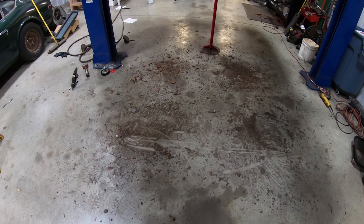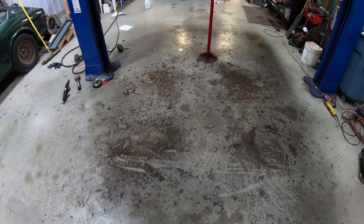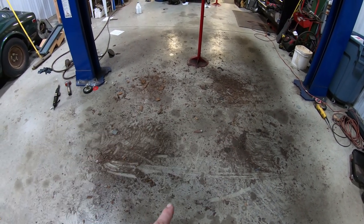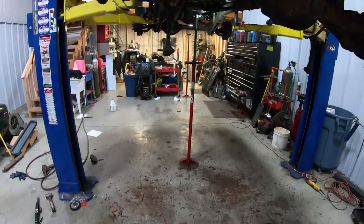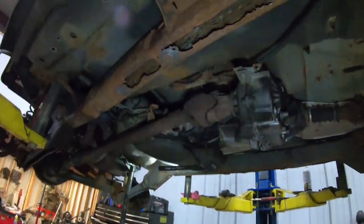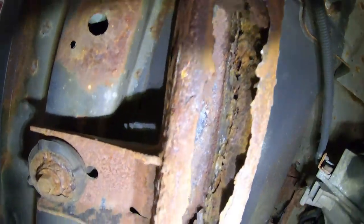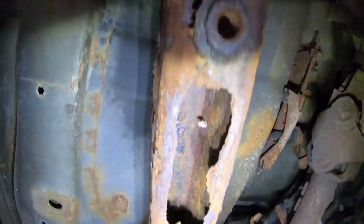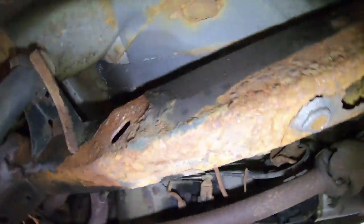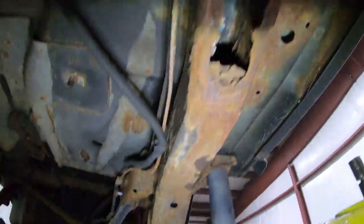You see all that stuff on the floor? We haven't even cut anything yet, we haven't started cutting the frame - this is all just stuff that fell out from taking bolts out of the thing. Luckily we got the skid plate down and only had two bolts that spun in the frame. But take a look at this - that's definitely some saltwater action because it's rotted almost all the way up, so we're going to have to treat the whole inside of that portion of the frame too, which normally we don't have to do. This one is pretty gnarly.